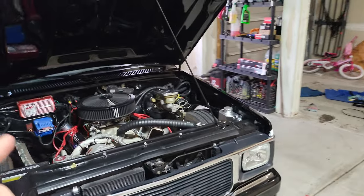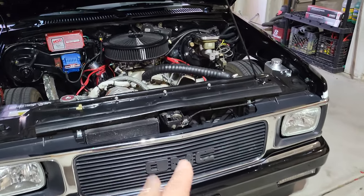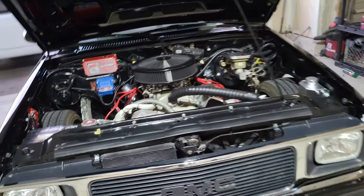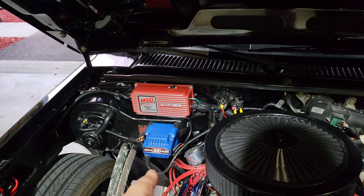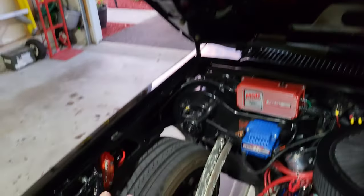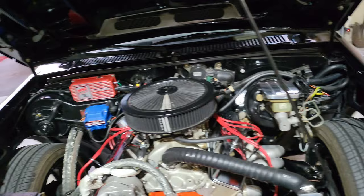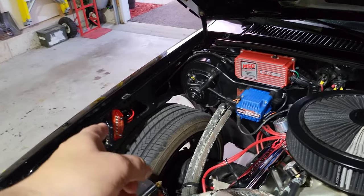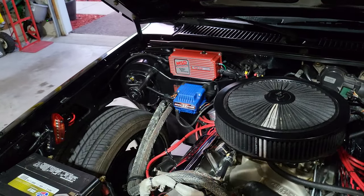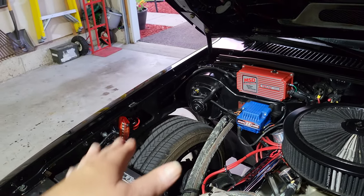Talking about the wiring — in the front I rewired everything, just tore it all out. Put HD HIDs in, rewired those. Dual relay fans, rewired everything from the front all the way back. Old school 6AL MSD box with a Blaster 2, rewired everything into the fenders. New blocks, new copper wires — you gotta use pure copper wire, not that aluminum clad stuff.